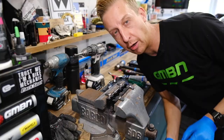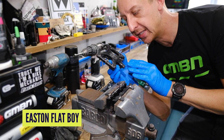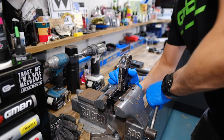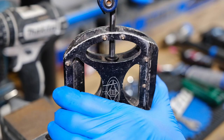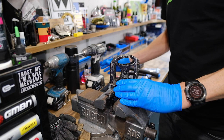First pedal — the Easton, representing any average flat pedal. Pretty simple. Going to get it in the vice. A 6mm Allen key takes that end cap off — it's normally a 6 or a 5 depending on the model. In this case, the actual cap doesn't come off through the outside hole in the pedal; you have to carefully reach in and grab it through there. What's important is to always make sure you lay the parts out in exploded order so you're ready to put them back in again.